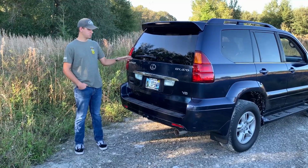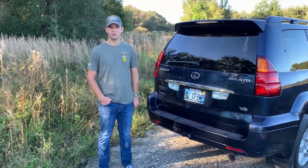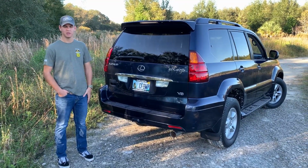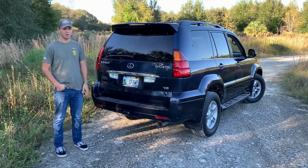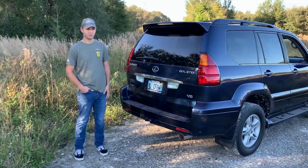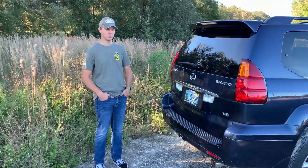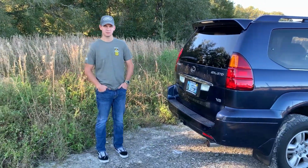As many of you guys know, these Lexus and Toyota 4Runners have a weak 8-inch rear end, where the weak design comes from the towers that hold the carrier. So to prevent breaking, we're gonna replace this with a big and strong 9.5-inch third member from the Toyota Land Cruiser, and we're gonna make our own custom fabricated housing, utilizing custom brackets and custom machined ends to fit this vehicle.